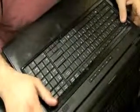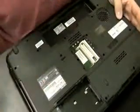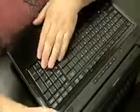You feel around, you look around, you see if there's a plate above the keyboard, below the screen. It's usually the key that when that plate comes off, and if you watch in earlier laptop videos, that's usually the key to getting the screen off, getting the keyboard off. And I can't seem to find one. Sometimes, especially with VAIOs, it's all one piece, and you have to find a different way to get the screen and keyboard off. But I think the solution will present itself here. If it doesn't, I'm going to fast forward it till I get to it. This is what takes time in the laptop repairs, guys. Figuring out how to get these babies apart.